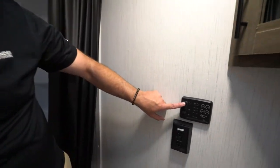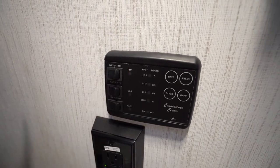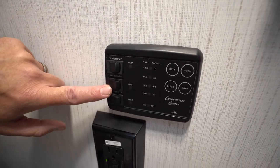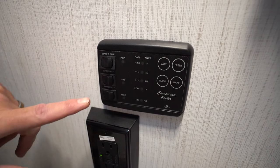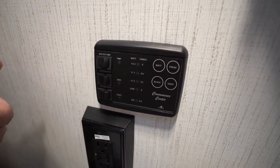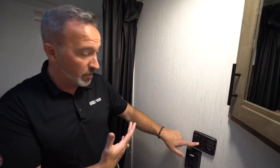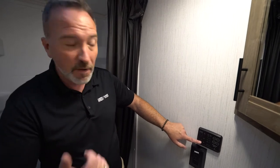Our control panel for this one is located right in here inside the bathroom. You'll notice we have our water pump, which you won't need to use if you're hooked up on city water — you only need the water pump if you're using the fresh water tank. You do have a six-gallon water heater bypass on this one that runs on either gas or electric. When you cut on the gas, that automatically cuts on the igniter for the propane water heater. But if you're going to do back-to-back showers and need quick recovery, you can cut both of these on at the same time and it'll double-heat the water for you.